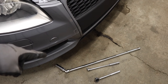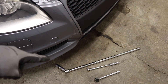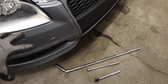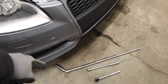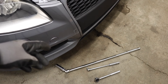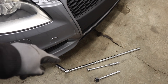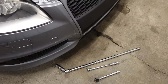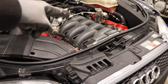Let's quickly revisit the belt tensioner. If you put a reducer on a big breaker bar on a lift, obviously use that. The big problem with using the small one is you don't have range of motion when you're doing that. The small one might be fine, but if you have a weak helper just put a quality 3/8 adapter on there. The middle tool is still the go-to. Going back to that evap line down there that was cracked but passed the cigarette smoke test — we haven't changed that but it's still on the menu.